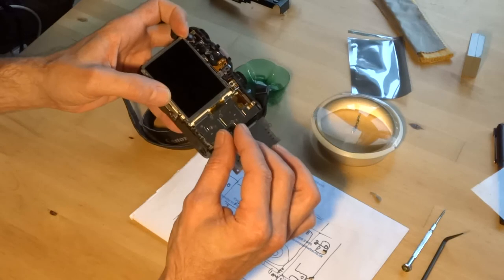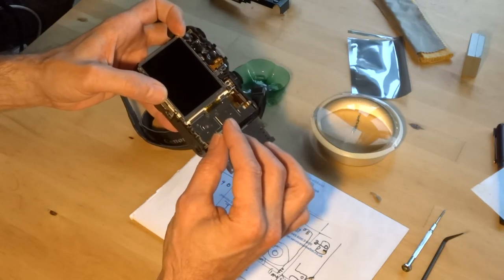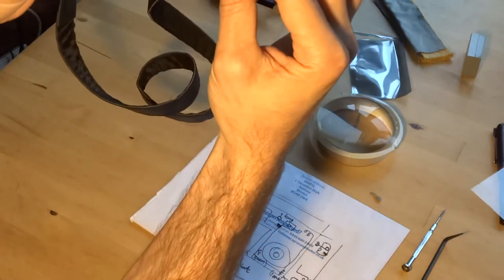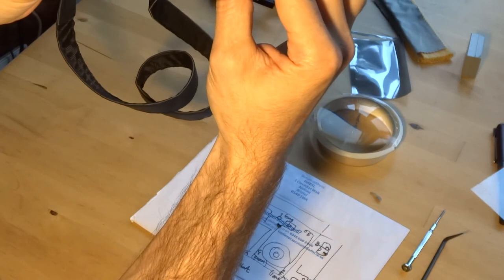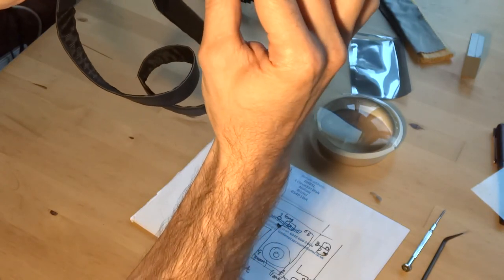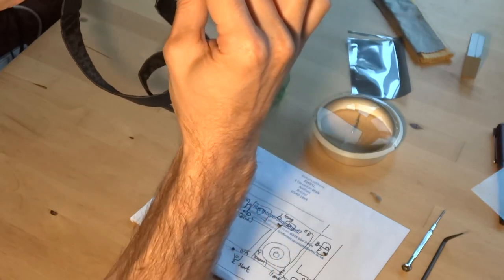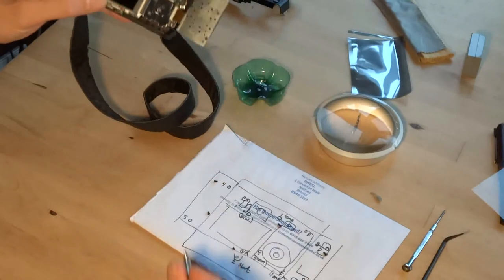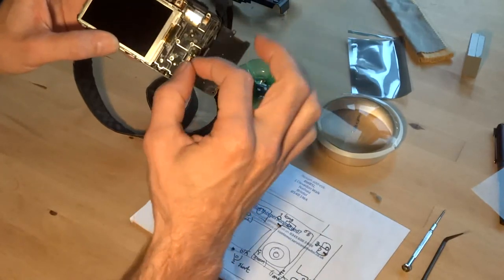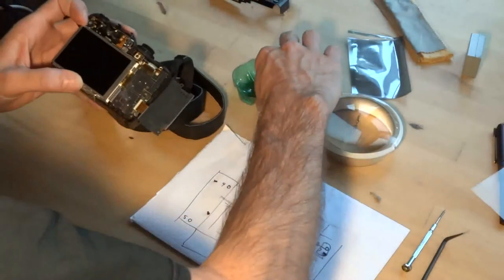Now, when putting in screws, reverse until you hear the click, and then gently go forward. Don't secure them entirely until you've got all of them in, because it can pull it off slightly and that makes it difficult to match the thread for the next ones.